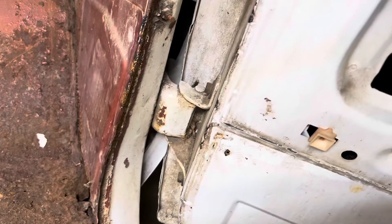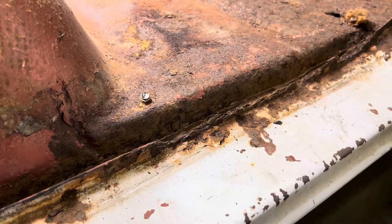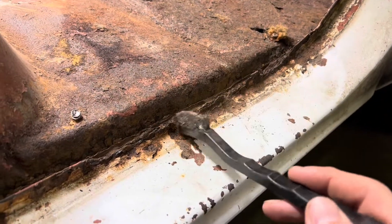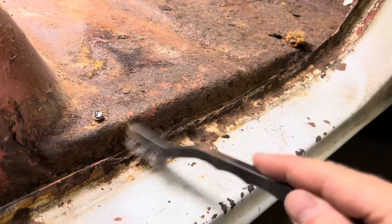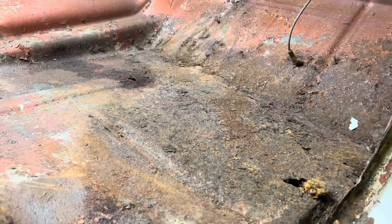This is what I've got to do - the kick panel has some rot in it, and the floor there, and some of the floor pan needs to be repaired. I didn't realize it was that bad, but on the other cab - the parts cab I'm using - it's actually worse than this one. So what I may do is cut some of this out from somewhere else in the cab, cut it out, spot weld it in, and see if that'll work. I don't have anything there anyway, so if it doesn't work it's no different. Got a few holes to fix, and the other side seems like more of a challenge.